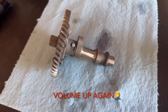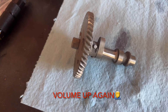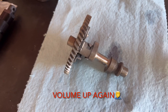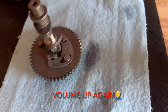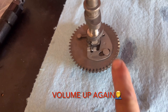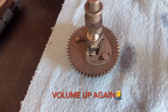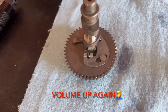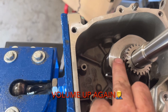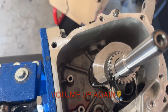Another area of interference is in the camshaft area — the connecting rod was sitting next to it. I have a six-inch bench grinder with a three-quarter inch wide wheel and I just go in there and massage that a little. Dyno Cams sells some specifically for 224 strokers that are already pre-clearanced, so those aren't a bad deal. But if you don't want one of their grinds, you'll have to buy somebody else's cam and clearance it. This cam also has a thin compression release, which is kind of made for a stroker engine. Other cams may have a different style mechanism and you may have to clearance the crankshaft in that case. With this crank from NR Racing it's already pre-clearanced — it's been up in the lathe and machined off.